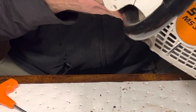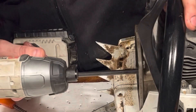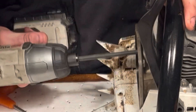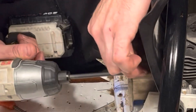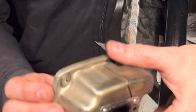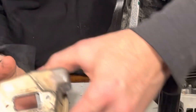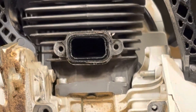Oh yeah, it looks pristine in there. Golly, this thing would be a lot better if it had some port work done. The exhaust is so small — it's all sport. It's got like a crush gasket, interesting. See that? Like a crush gasket. I've now uncrushed it. Look how small the exhaust port is on that thing — that's awful. I think the intake is bigger than that, which is crazy.